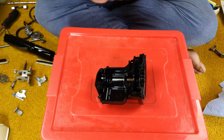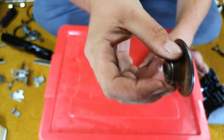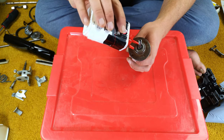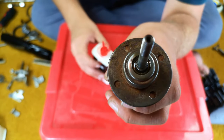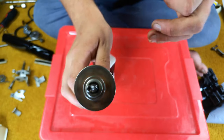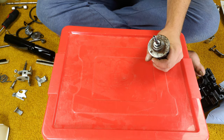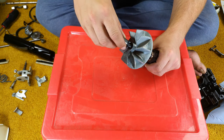Whilst we fill up our motor housing — actually, before we fill up our motor housing we need to build our armature. It starts with the front bearing, which has been soaking in Auto Smart Tardis — anything like that will do. You pop that on and, tips down below, I just fill it full of oil. You want it to soak right into the little felt pad and it'll drink it up. That is now spinning much more nicely — it'll change your vac's performance as well. Then we take the fan spacer, push it in, our two washers, our two fibre washers — oddly they did away with those at some point — then our fan.